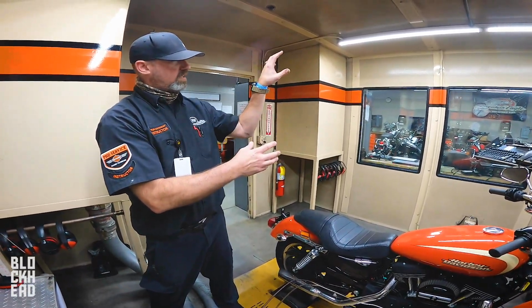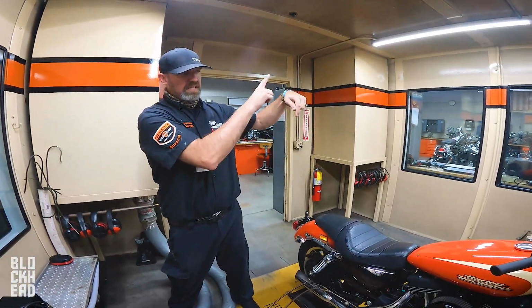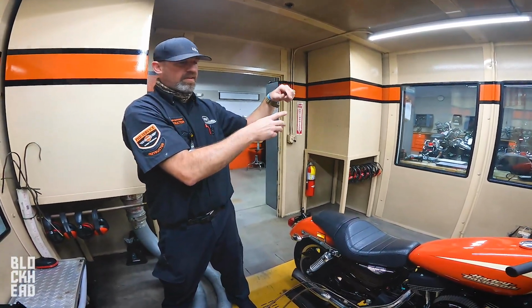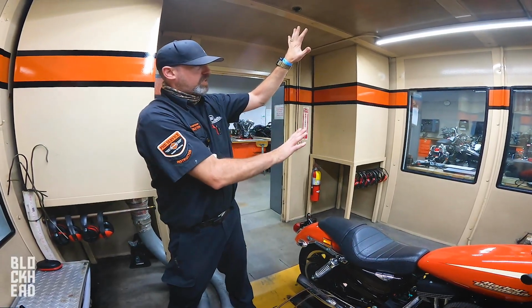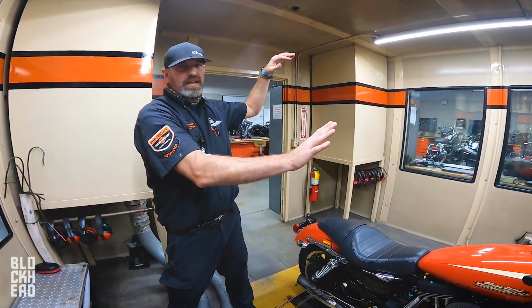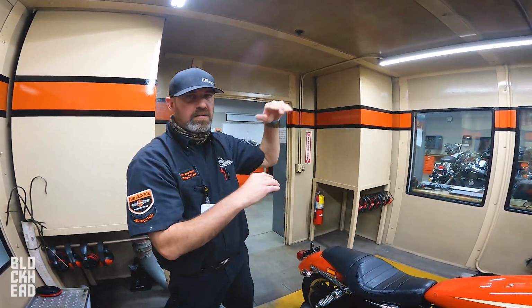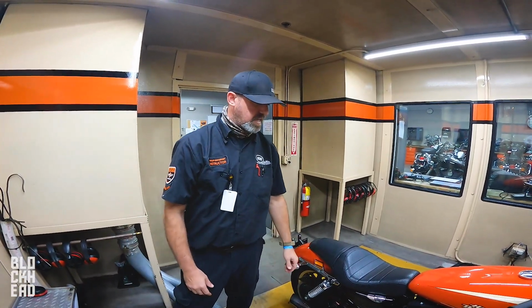So you can look at the dyno, you can see where I shut the throttle, and you can see where the air fuel line goes lean at the exact same spot. That way, whatever I see in the graph and whatever I see on the bottom, they react to each other. Older dynos, there was a delay. So something would happen up here, and then you would see something on the bottom, and it was kind of a pain in the butt.